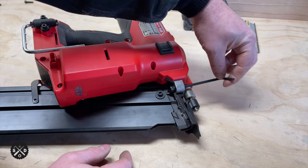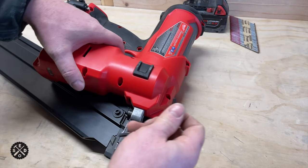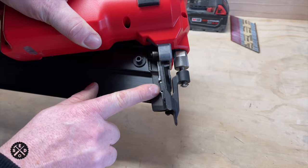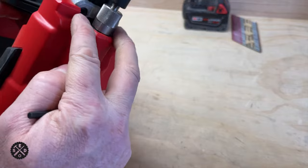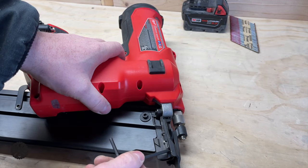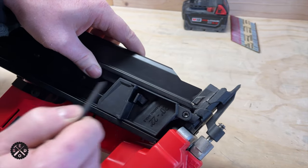Here's attempt number two — this is the one where I took a little more off. Now see that gap — that was the problem last time when the bolt was going in and it didn't want to suck nice and tight, which it has to be. I'm trying to do this left-handed so I don't block the camera. I think it's going. Before I snug the other side, I'm going to get this one in. I think it's going to work — this is nice and tight this time around. Got just enough clearance right there. So I got those bolts back in, checking it out. Everything looks nice and tight. The gap right here especially — and the same on the front. The bolts line up and everything lines up.